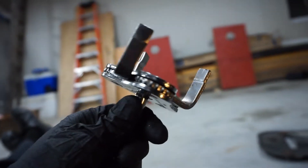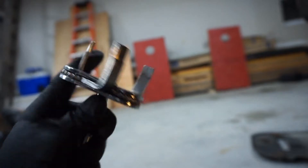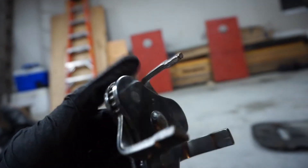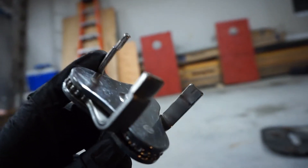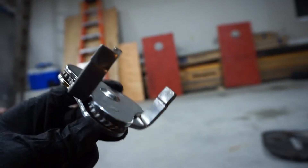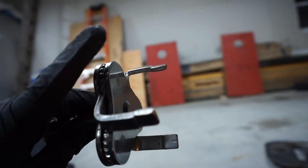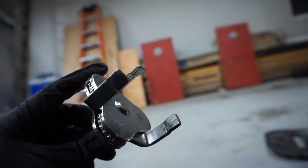This one you cannot, so we'll go get a tool for it. This is a tool designed to get oil filters off — it grips around it and twists them off. Never use it to tighten though. You don't necessarily need one of these; people have used screwdrivers hammered into the side. But these from AutoZone are just a couple bucks and are very handy to have.